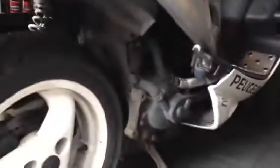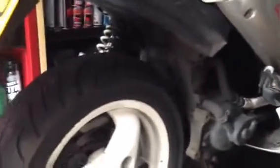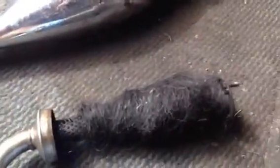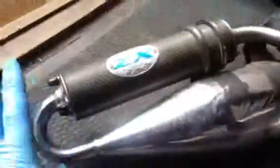These engines have to have back pressure to get them going. So when you put the bigger air filter in and upjet it, it's pushing more out but needs to breathe. And when it's like this, you've got no pull away — it's just not pushing back on the piston enough. It's all coming out and you're just going to go slow. So that's the answer today. I'm going to rewrap this one. It's as simple as that — just cut that to shape, enough that it goes round at least two layers touching here. Wrap it round sensibly, band it in a couple of places, put it all back together again.